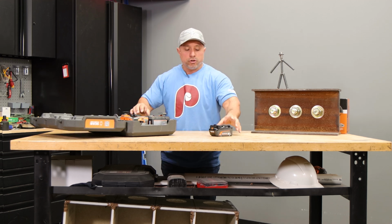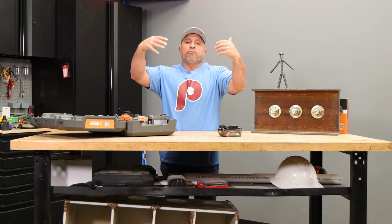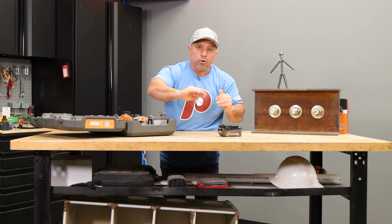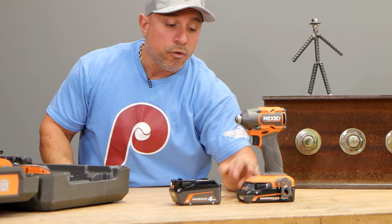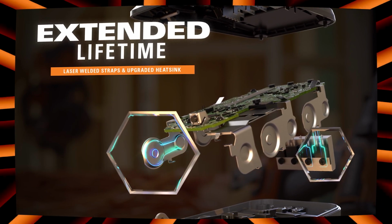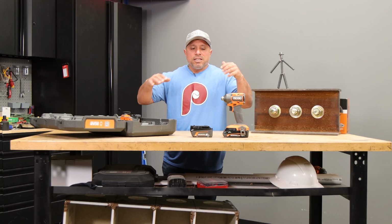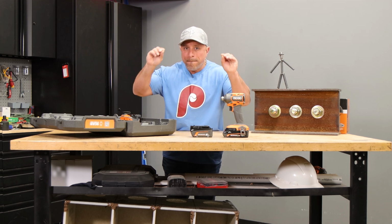If you try doing that with traditional packs, maybe not using either pouch or tabless cell technology, you're going to cause a tremendous amount of resistance. Resistance causes heat. Heat is what damages batteries and shortens their lifespan. These tabless cells, long story short, do a great job of staying cooler in those situations like rapid charging or high draw applications. And that's why I wanted to make a whole video about this, because this battery is literally the next step in the evolution of power tool battery technology.